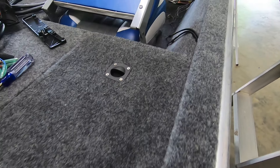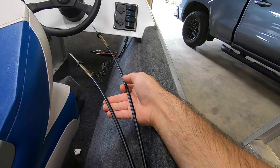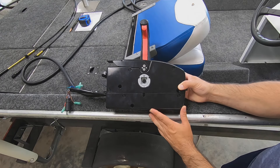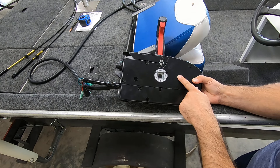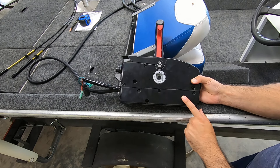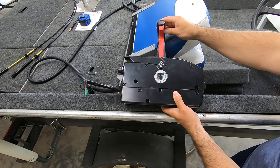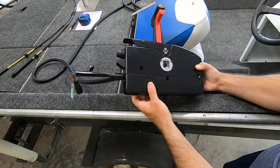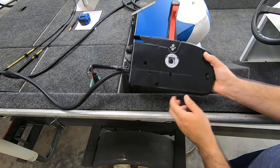All right, I've got those routed through and they're coming out this hole right here. So now we can connect them to our controls. We're going to connect the cables to the throttle control first. That way we'll be able to tell which cable should go to the actual shifter for neutral, forward, and reverse, and then the actual throttle control. You can tell when you open this up — you can see which one moves when you change gears or change throttle. First thing is to take out these couple screws and expose underneath. The throttle cables come in through the back and you can see the mechanisms where they attach once we get this panel off.